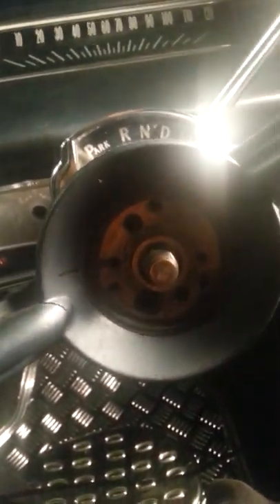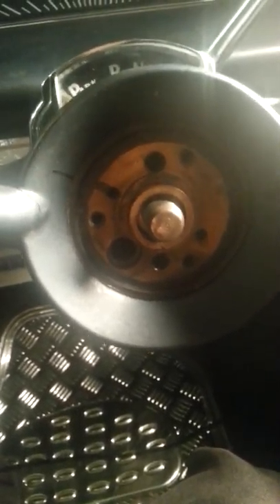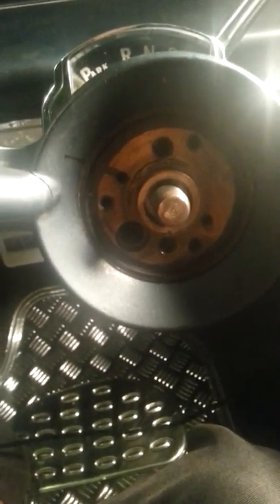What I want to do is put the steering wheel right in the middle, even though my marker's off as you can see the black mark line. What I did is I leveled out my steering wheel and checked the front tires to make sure they were straight. Let me go ahead and recheck again. Yeah, my tires look straight.